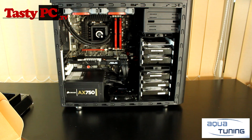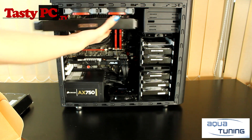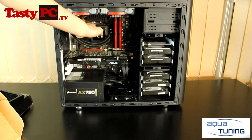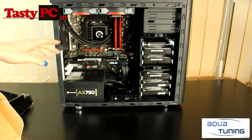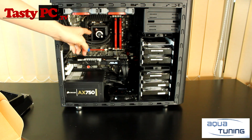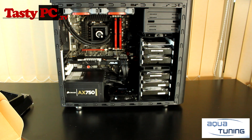So that's all the parts. The plan is to have the radiator here, and use a 90-degree angle fitting so the tube goes straight back and behind the radiator, straight into the reservoir — hopefully most of that tube will be hidden. Then the tube goes straight from the reservoir to the CPU block, and straight from the CPU block to the radiator. So it should look hopefully quite tidy and simple. I'm not sure which way I'm going to have the flow going yet — it just depends which way I think looks better.